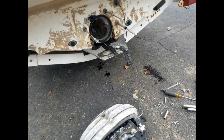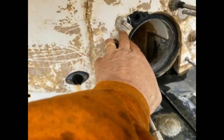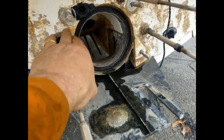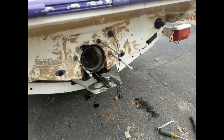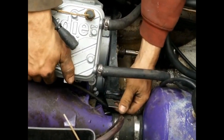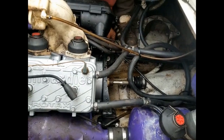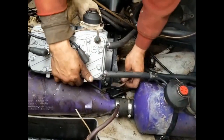I have seen people put shims in behind there to move that out. And if you look here, you can kind of see a shim right there — there's an old shim right there on it. So that is probably one of the things that was happening here. We're gonna try to adjust the dampers so it doesn't put so much pressure pushing on the engine — aligning the jet pump to the engine. We got our thing in there, sticking a couple shims in here. That's too much. Those bolts are so short. Okay, we're gonna add another shim — it's still a little bit tight. I'm gonna put a thin one on this side too.